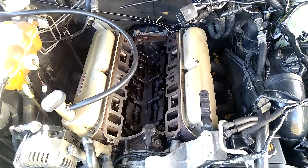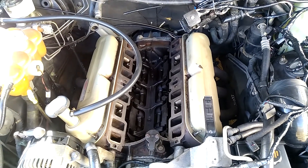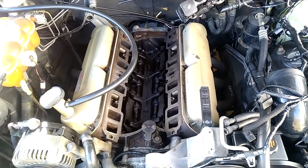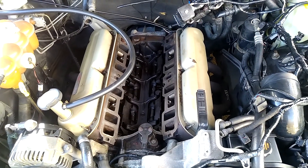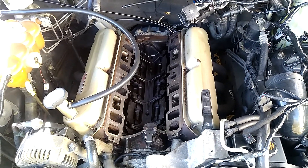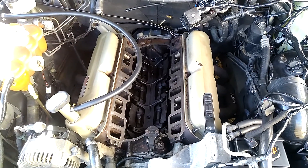Reflecting back on it, it's a lot like an old points ignition system misfire when you've got a set of shitty old worn out points. So I have gone down the garden path of trying practically every component in the ignition system you can imagine — new ignition module, different coils, different leads, different plugs — everything except the crank position sensor.